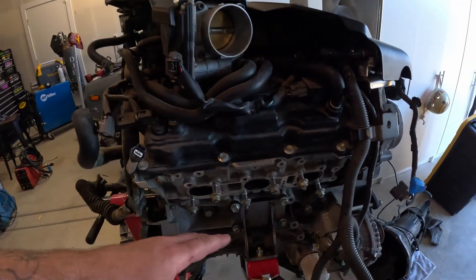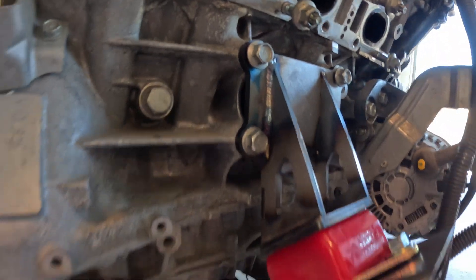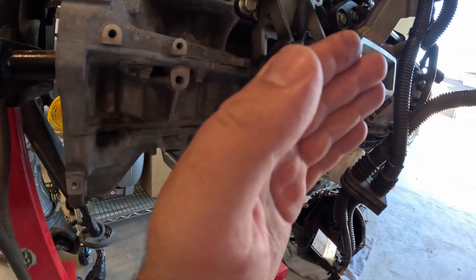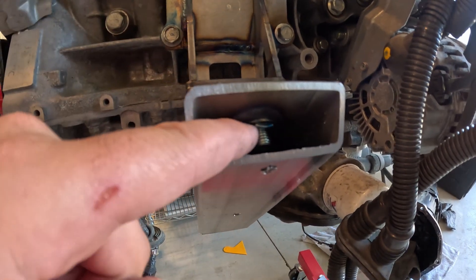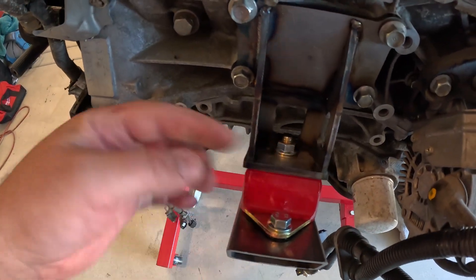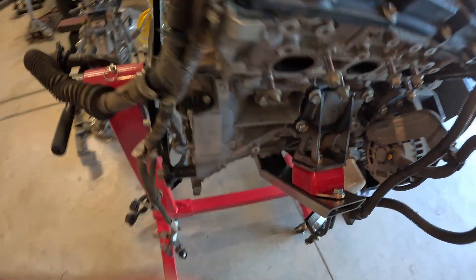After a bunch of work, we're making some progress. I've got all the engine mounts welded up looking good. This cross tube I've only tacked in place just in case it has to come back out or I need to make some modifications — in case the width is not correct between the frame rails. I welded in some stainless steel nuts so that the top of the motor mounts can bolt straight into the cross member. The bolts here give multiple points of removal. Shouldn't need to touch those bolts for the most part. Same thing on the other side.